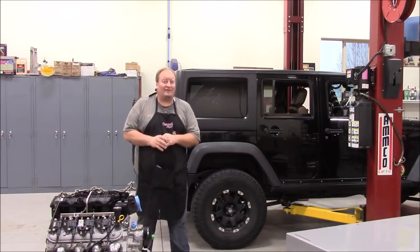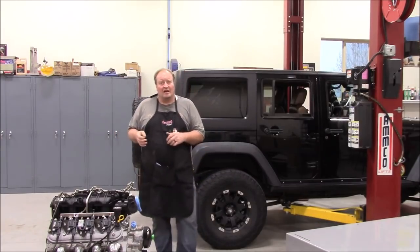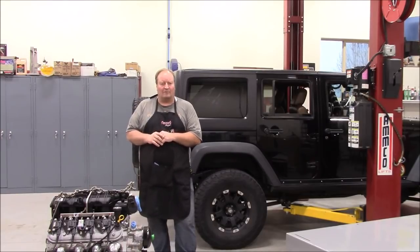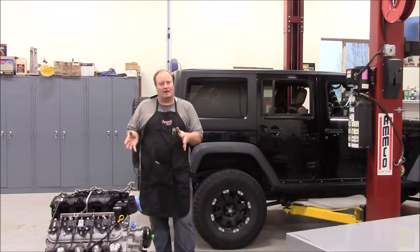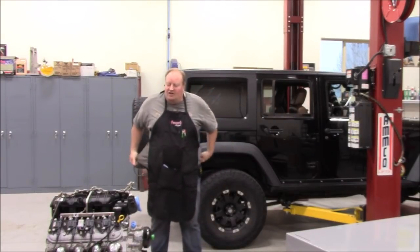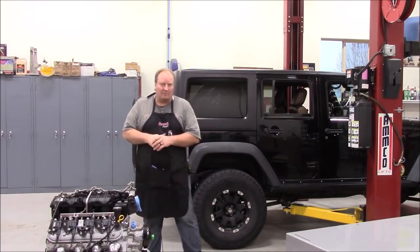Back to the engine: it's a 2010 through 2014 6.2 liter truck/SUV engine. You can get the LS3, which has about 25 more horsepower but only about 6 or 7 more foot-pounds of torque. I preferred the truck Denali/Escalade SUV engine mainly because of low-end torque. It's a VVT engine — discrete VVT, not like the Gen 5 engines with continuously variable valve timing. Off idle you have over 350 foot-pounds of torque available right on tap. These should move a heavy JK very easily, and they idle smooth all day long.